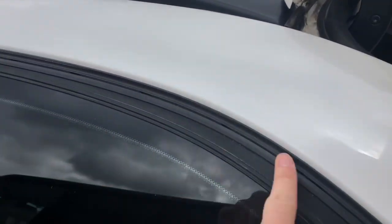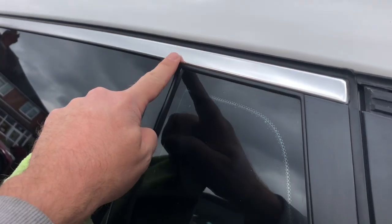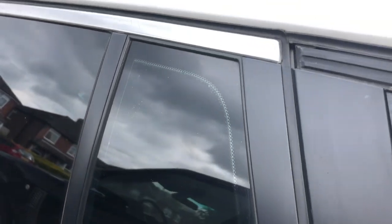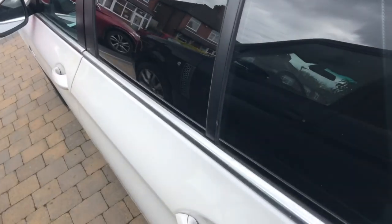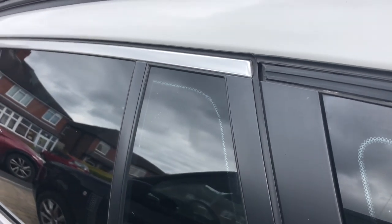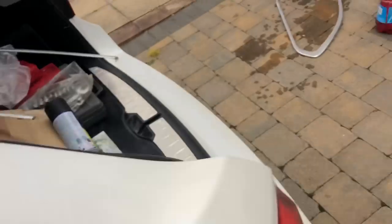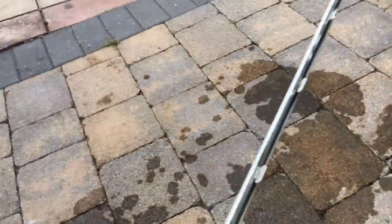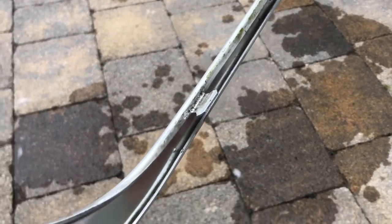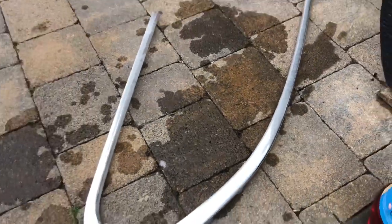After you've removed those two, because they're dead easy to get off the back, all the other ones need a good clean down. As with any paint prep — Plasti Dip is a lot more forgiving than normal paint, but it still needs to be clean to go on. Even when they look relatively clean, you'd be surprised how much dirt comes off these silver trims. I've rubbed all these down with a traffic film remover and then I'll give them an alcohol wipe down before applying the Plasti Dip. The dirtiest ones are at the back bottom where all the dirt accumulates as you're driving.